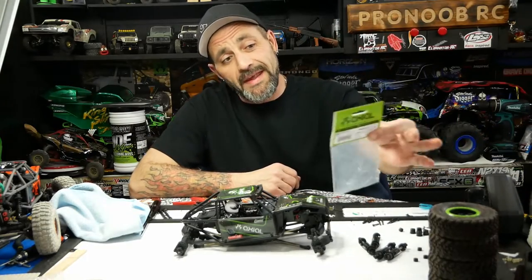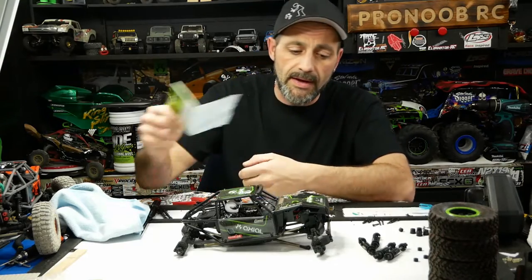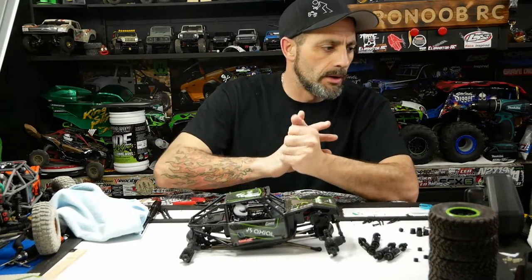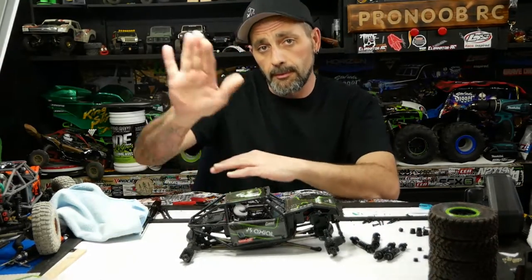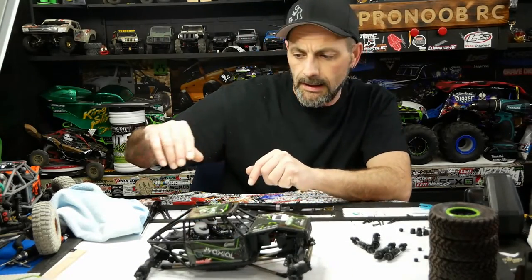Steering link set is AXI 314002, and that covers your links in the front. We got two of those for the four-wheel steering in the rear, so it's gonna look nice, have the matching set front and rear. I know a lot of guys transfer the plastics to the rear when they do it, but you have a lot more load on your rear steering going up and stuff too, right? So you're gonna want that to be your strong point. So anyhow,